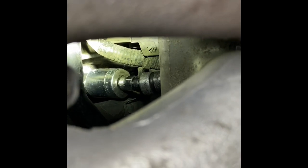So yeah, it's a knock sensor. You do not need to seal the threads. You do not need to put anything on them. You do not need to tighten the piss out of it, kind of like a spark plug. I ran it in by hand. And we're just going to barely nudge it here, just one-handed with the little ratchet. Just do a little snug. See if we can shake off our glove, which we did.